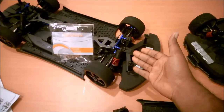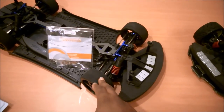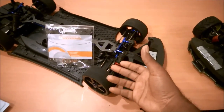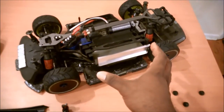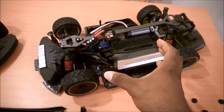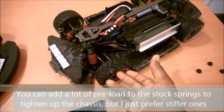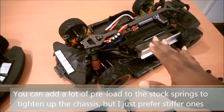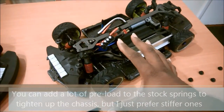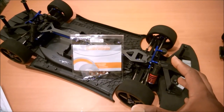And you see how this car was set up. The ride height was actually dropped really low, and it's probably a little too low for this application, especially using new tires. But it's dropped low, and there's a lot of preload. Basically, you're really limiting the suspension motion. And you look over here, that's how Dizzy's set up. You don't want this guy to move around a lot. By having a high preload on the shocks, making the suspension very stiff, it's going to be quick and responsive to bumps, which is what happens at 100 miles an hour. That's one of the big bad things about the XO-1 by stock.